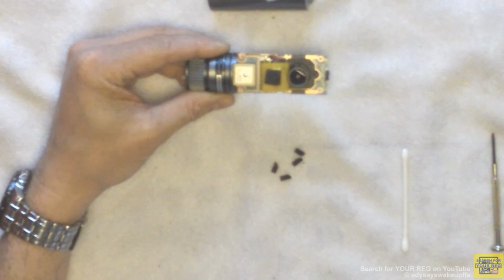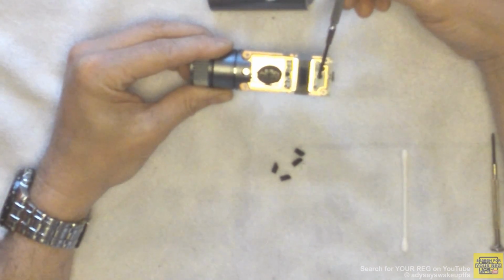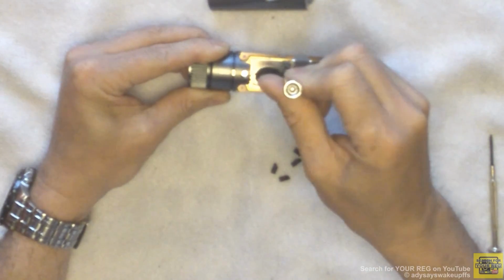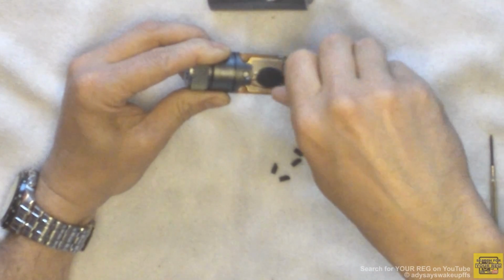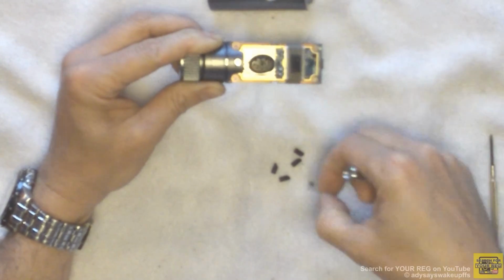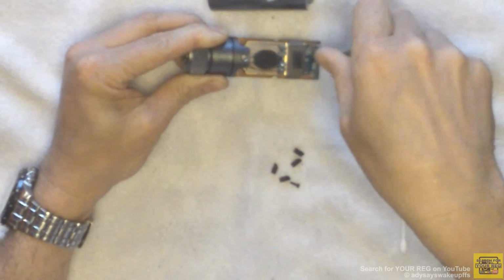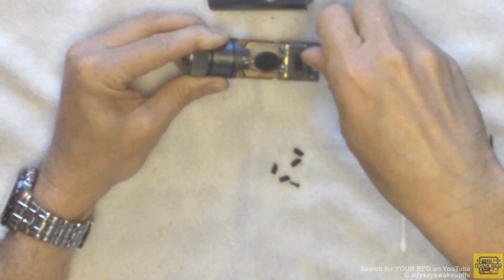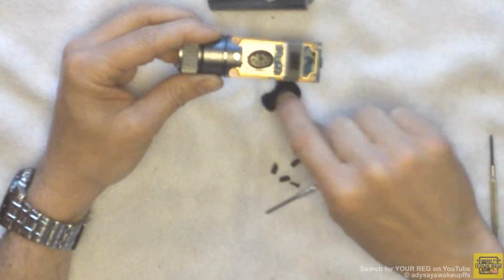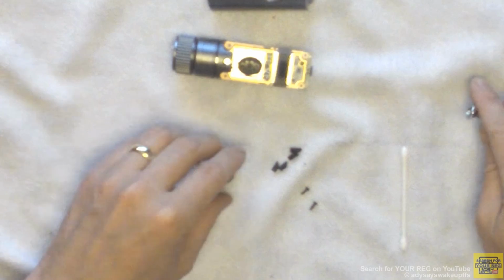The fourth step is to remove the lens from the camera. This is done by unscrewing the two screws on the reverse with the Phillips watchmaker screwdriver. With the camera lens removed and the sensor exposed, it might be an idea to keep the camera facing down so that dust does not fall on the camera sensor.